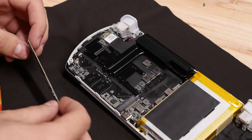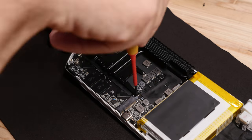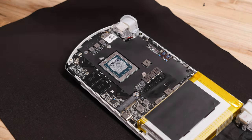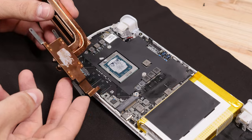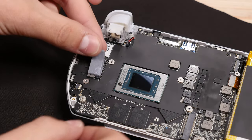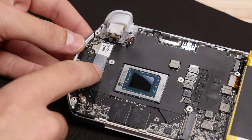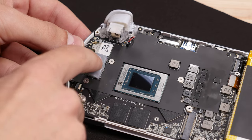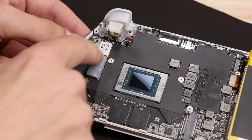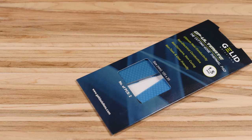I'll go ahead and remove the current M.2 as well as the other three remaining screws holding on the heatsink. Once the heatsink is off, my unit didn't have a great thermal paste application. After cleaning off the old thermal paste, the first thing I did was add a thermal pad on these modules here. Interestingly, I saw other GPD Win 4 disassembly videos and they already had a pad here, but mine didn't — even though the cooler is designed to cool those modules, so it wasn't really making contact with anything.